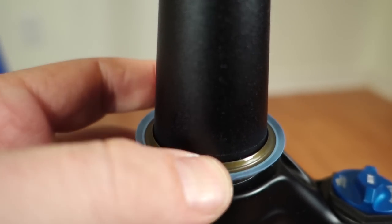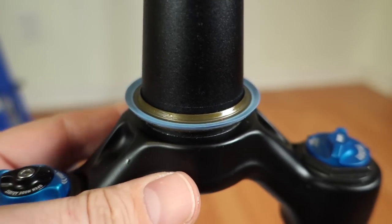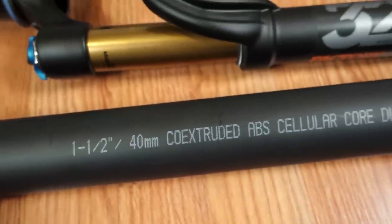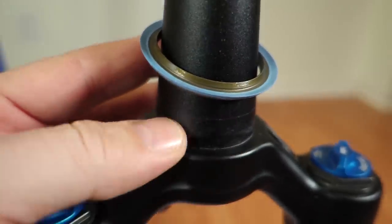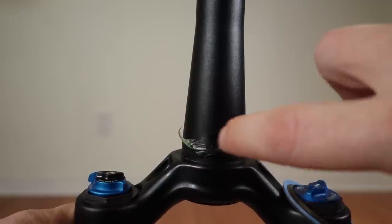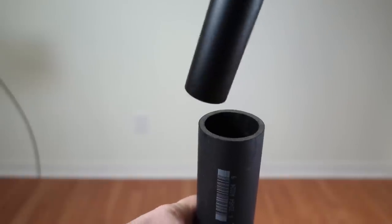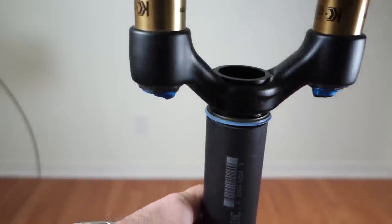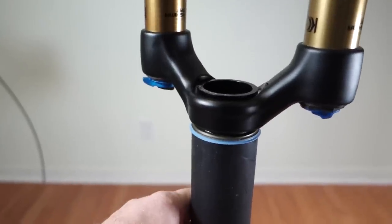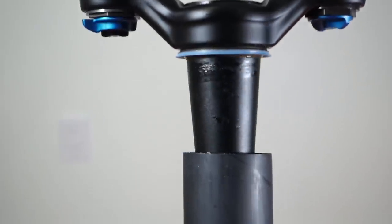In my case they're made out of steel — they're one piece — so I have to press them down. That can be done with a DIY tool: just a piece of 1.5-inch PVC pipe from the hardware store, which is exactly the dimension of my steerer tube. Get a little bit of grease on the steerer, slide your crown race, then slide it upside down onto that PVC pipe and bang it on the ground until the crown race buttons up. And that's it, you're done.